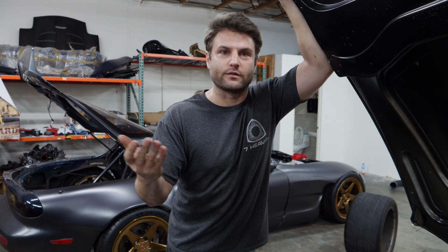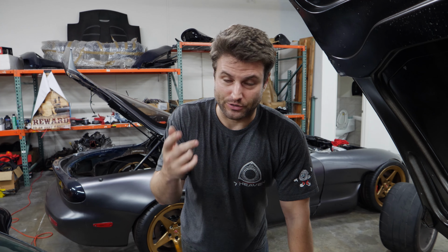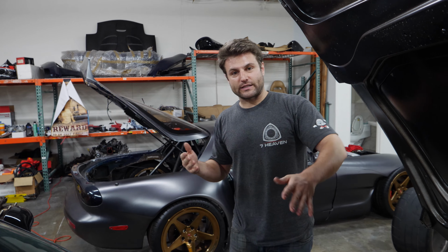And so right now we've got the oil coolers in place. Now we're going to upgrade this to the most ultimate E85 setup possible. Why E85? Well, first of all, it's one of the best upgrades you can do to a rotary. Why is it such a big deal? E85 is nasty stuff. It gums stuff up, it's corrosive to the wrong type of materials. So we've got the best of the best to make the ultimate E85 setup for any two rotor rotary engine.